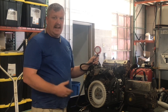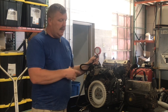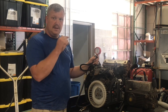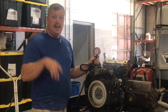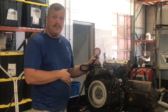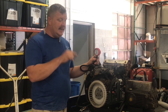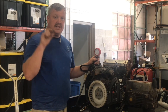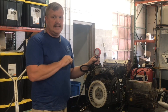Once those plugs get fouled out with oil, it won't start no matter what you do. We're going to put new plugs in — I'll put the link below for the new plugs, new oil filter, oil, and even the air filter for a complete service. Hope this has helped you with this motor. This procedure works for the GX690 as well as the 630. Just one little bit of overfilling the oil can make this engine not run.